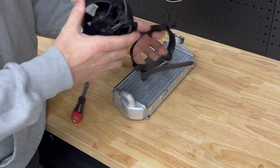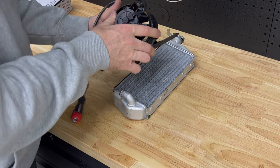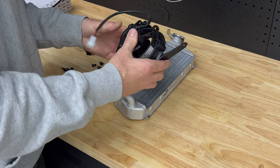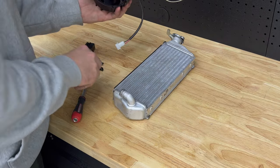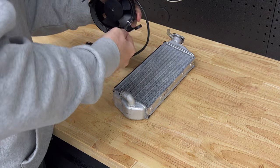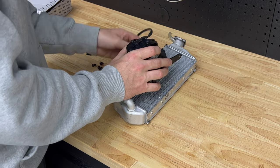The fan will need to be installed on the mounting bracket first as the screws come in from the front. Use the 4 longer screws provided. Orientation of the wire on the fan isn't super crucial as the wire has enough length, as long as it's not oriented on the furthest side of the fan. I chose mine to be oriented to the top.